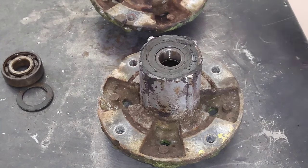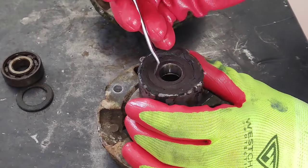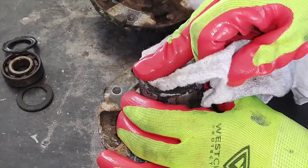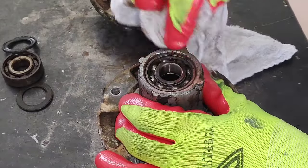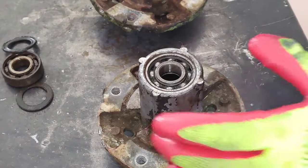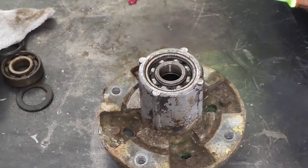And one thing, guys, I will say, out of customers, I've had many customers. I've replaced probably hundreds, if not a thousand, of these spindles, and they don't last forever, but they do last longer out of the customers that I see that maintained their spindles and grease them. The customers that don't seem to maintain their equipment as well, I notice that they have to replace these far more often. The one in that video where I got these two spindles, the mower had about 400 hours on it, which I think is mind-boggling for these spindles. I've seen them be replaced as early as 30, 40 hours.